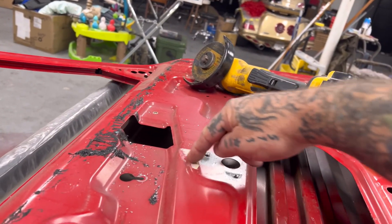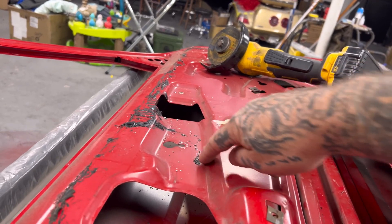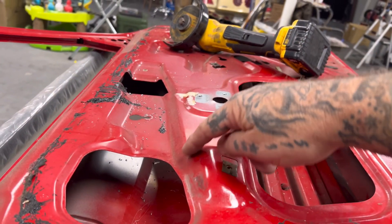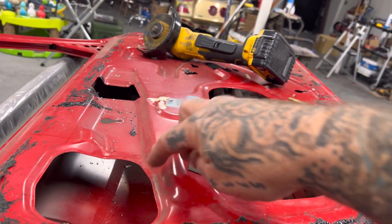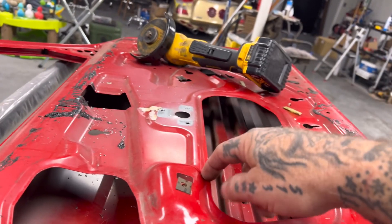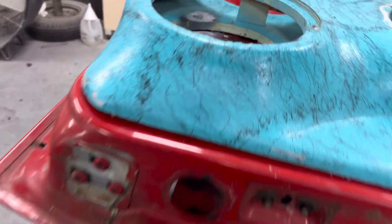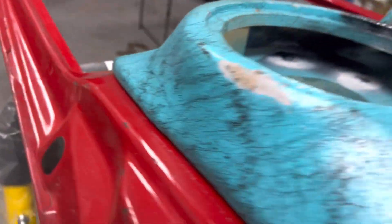Last time I cut this whole section out, my door popper goes somewhere in here. So when I cut this out, it's going to really weaken it — and it broke like here and here. So we're going to weld a piece of steel across here. Hopefully that'll be done. I got the panel laid up here and lined up — I did the old spray paint trick, hoping that it'll mark the door for me where it needs to be drilled and the rivet nuts put in.